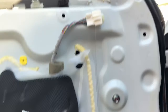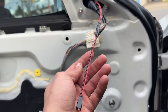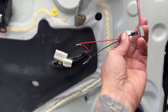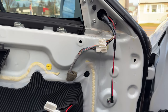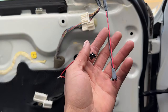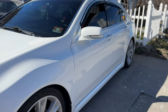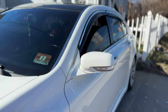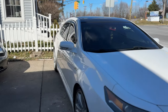I got the mirror in right now, everything plugged up. I spliced these pigtails onto the harness so I plug it into this — that way if I ever want to take the mirror off I won't have to cut the cables, I could just come over here and unplug it just like the main harness. Like I was saying, you guys can't even tell the lights are there unless you come here and go underneath. Here's the other side — measure once, cut twice.